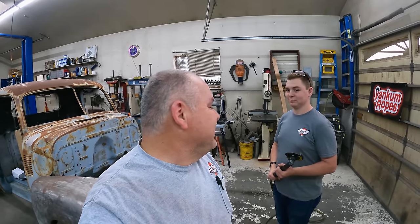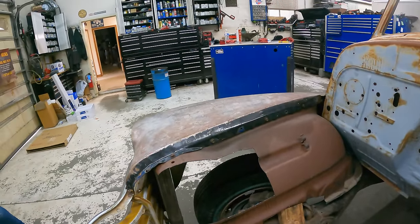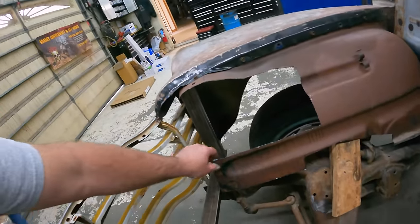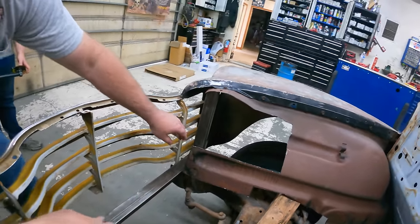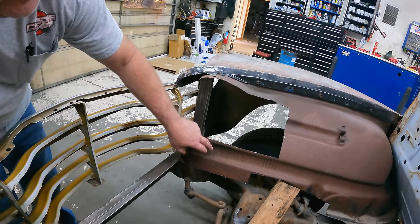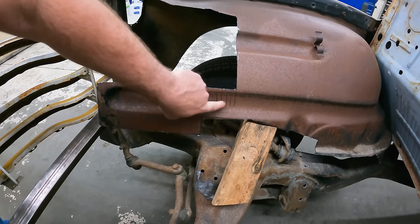Got Kenner's truck back in the shop after the work week. As you can see, Kenner's loaded for bear there. Going to cut more pristine sheet metal here — that's just kind of how we are around here, a bunch of hacks. So we need this piece right here to fold in to come into the radiator support. In order to do that, with the way this bend is, we're going to take and cut some pie cuts. We're going to start with four.